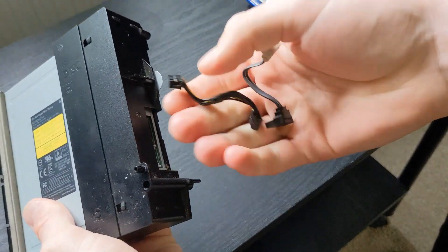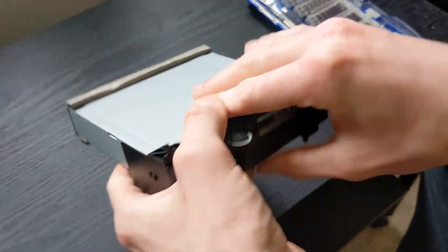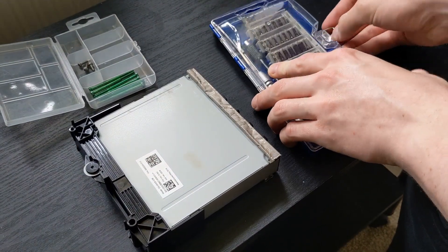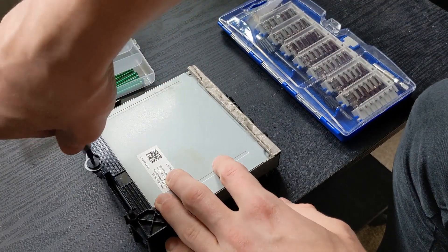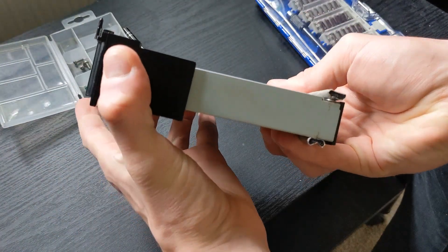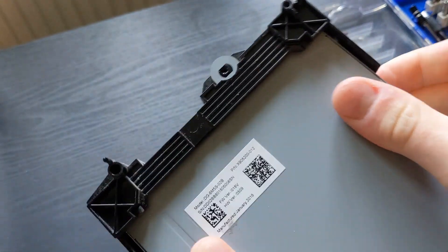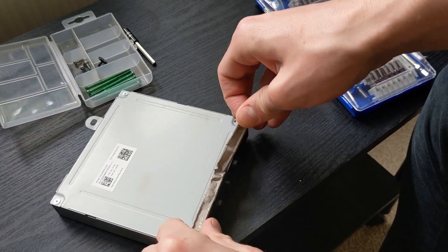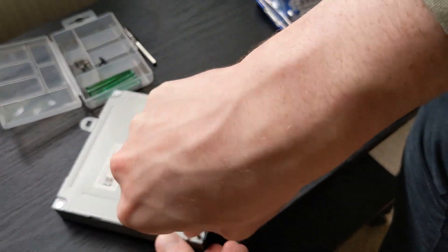Once we've got the disk drive, let's unplug these cables. I like to do it now because when we put this plastic cover back on it just makes it a bit easier. Grab a little cut here to put the screws in. This first screw is a T10 and it's going to be the only T10 from here on out — the rest are Phillips. Take this plastic cover off; don't be afraid, just pull it. If you're struggling, pull this metal tab down and it should go right off. Now we've got this metal sleeve — there's a foamy padding we'll take off and leave sticky side up.